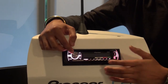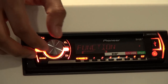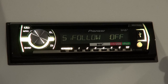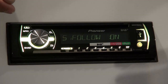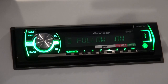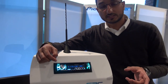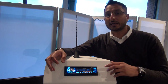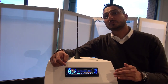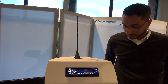So let's turn the unit from demo mode off and we're into DAB. The first thing you need to do is go into your menu — just push the volume controller in. You switch around, you've got different menus, but the one we want is Function. Press that, and if you want to select it on or off. So if it's on, when you're listening to a digital radio station — for example, BBC Radio 1, which is available on FM as well — as you drive around, once you drop signal, there's a signal level meter on screen, and it will auto-switch to FM. When the signal comes back in for DAB, it instantly goes back to digital. System Follow — a feature of digital radios from Pioneer for 2013.